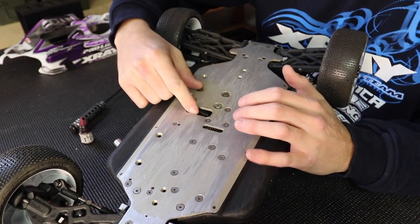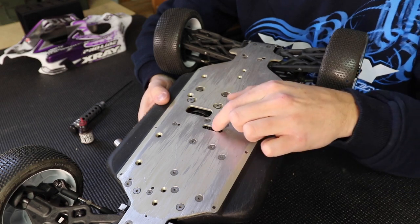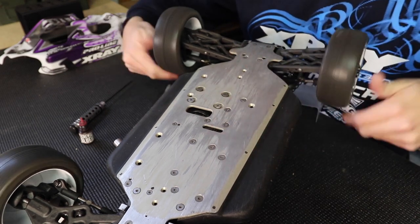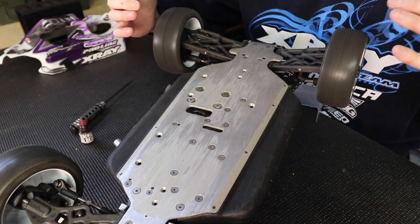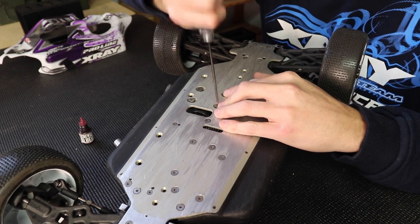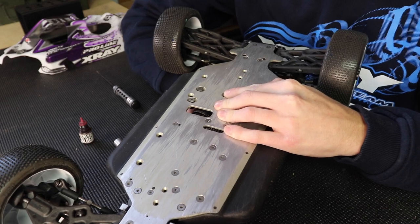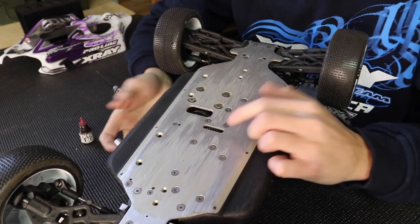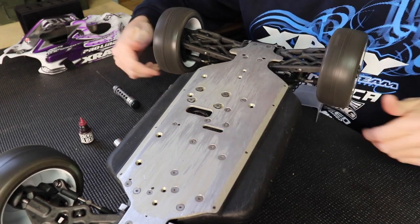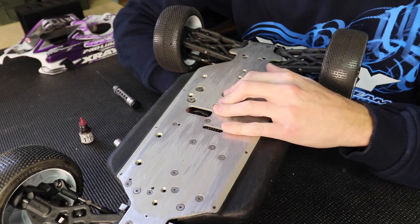What I'm doing is holding the clutch bell and wiggling the spur gear. I'll reach under and grab the clutch bell from the bottom. There's no play there — you can hear that. There's no play and it's too tight. Make sure those screws are loose enough. Wiggle the motor over just a little bit and check for play again. There's more play but still not quite enough — it's still noisy, so I'm going to move it over some more.